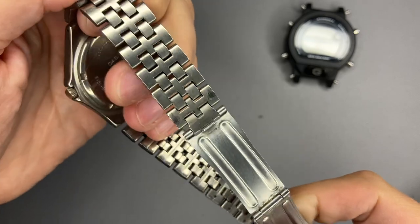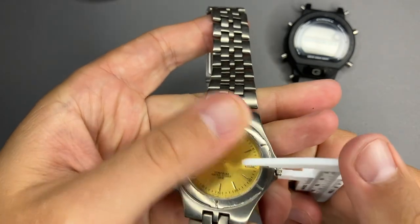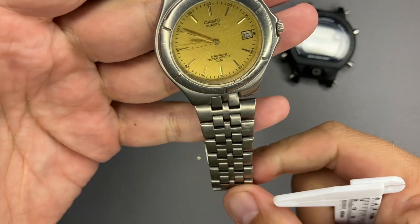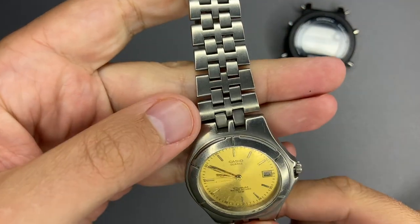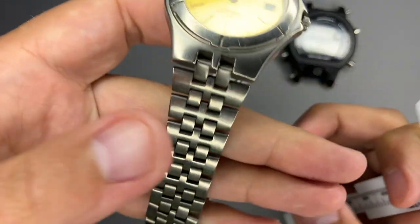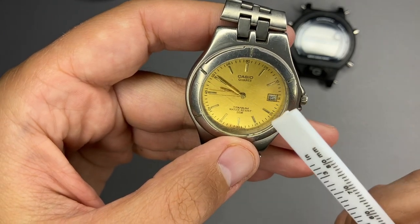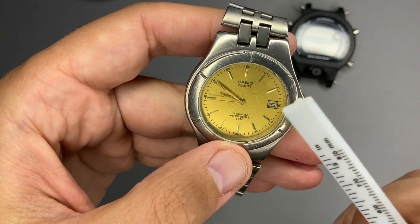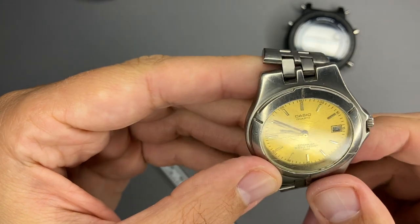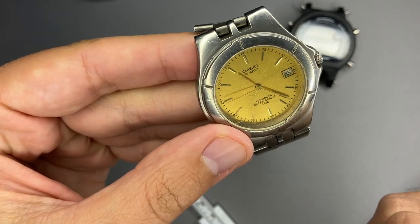The case still looks good considering its age and wear. The screw back case indicates that the watch is qualitative - it is not a cheap Casio, it is an expensive Casio. The bracelet might be original but I cannot tell at this moment, and even on the internet I have not found pictures of this watch. Regarding the thickness, this watch is pretty thin at nine millimeters - it is somehow a dressy watch, maybe better suitable for a woman, but I would say that on a thin wrist a man could wear it. The battery is an SR626SW; I have used an LR621 which is smaller, and the mechanism may be damaged or the battery has moved from its position, which is why the date cannot be adjusted.